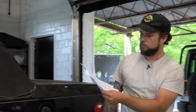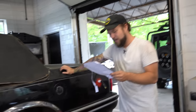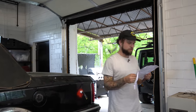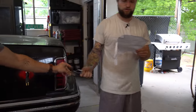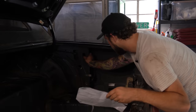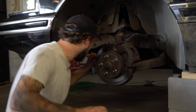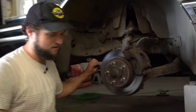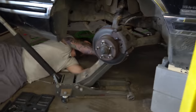Depressurizing the air springs has a lot of steps. Locate the air suspension switch in the trunk and turn it to the off position — I think it actually already is. Turn off engine — done. Disconnect battery — we didn't do that, but it's off now. There's spiderwebs everywhere — it's a horror story sticking your hand in there. I finally got the battery disconnected. We did the step, just in the wrong order. Need to put a jack under it so the suspension doesn't just shoot down.